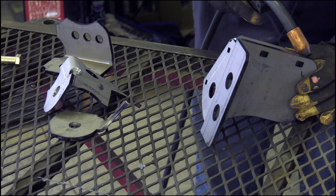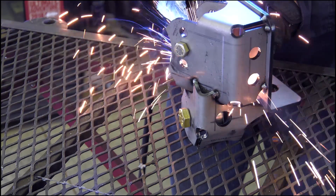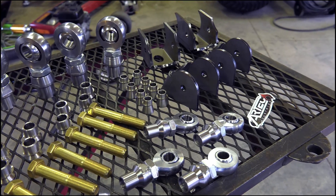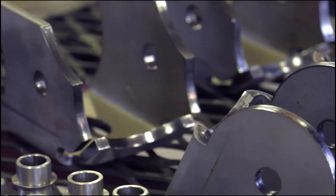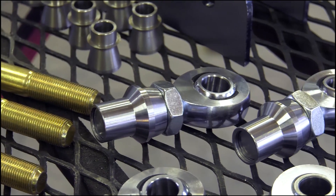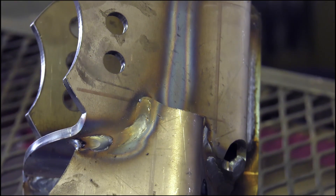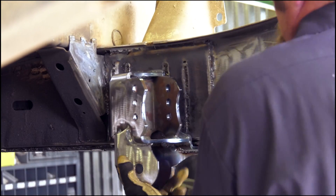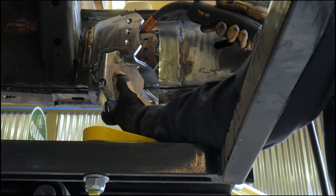Then it's time to build the suspension. For this truck I got a four-link kit from RCTech Industries, and I love their four-link kits because it comes with everything you need — brackets, tabs, heim joints, misalignment spacers. It's all laser cut, super nice steel, and it even comes with the hardware to bolt it all together. The frame-side upper and lower mounts key together away from the truck and basically become their own little superstructure that, once fully welded, I can bring over to the Comanche and weld onto the frame stiffening plate I added before.